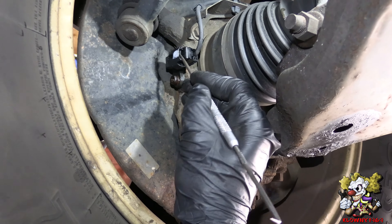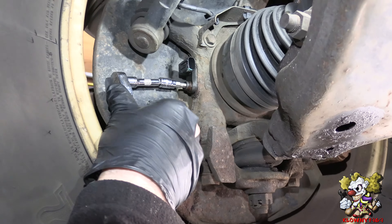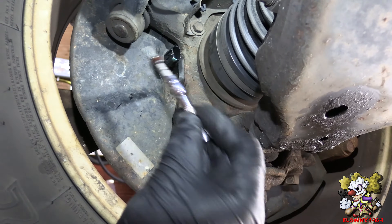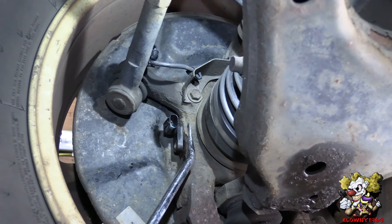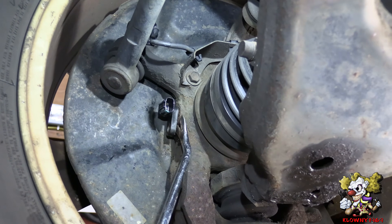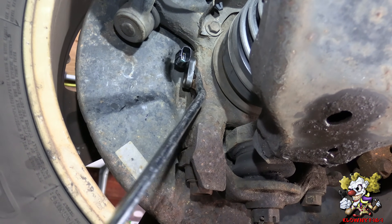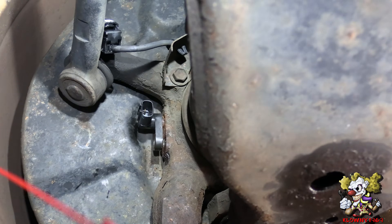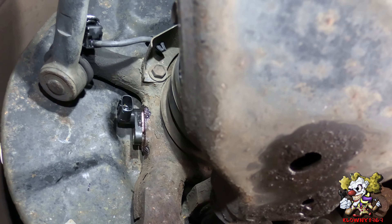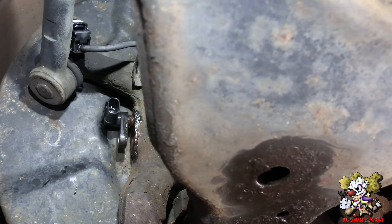Okay, now we're going to replace the sensor. In this car you just have to push this clip down and pull it out. That's a 5mm Allen right there, so take that screw out. Now to pry this off, see if you can get behind there with a pry tool and gently finagle it out. It's been years since that hole's been exposed, so you have to be very careful. It's going to need some lubricant — my favorite is Kroil — so just spray it on there where it goes inside the hub and try to finagle that out. A little bit of lubricant makes everything better.